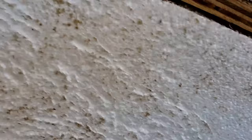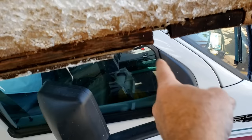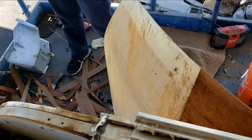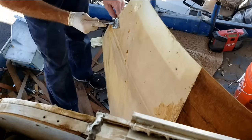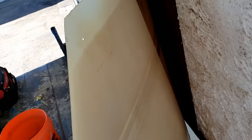You can see the plywood in the front cap did get wet, but it's not rotten. It's definitely been getting wet down here too. All that adhesive is now scraped clean — no adhesive remaining on the surface. Now we can get a piece of luan, glue that on, and glue this back together. I'm still a little concerned about this area — not sure what can or will be done about it.